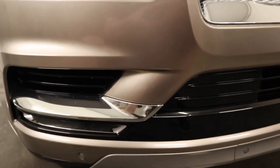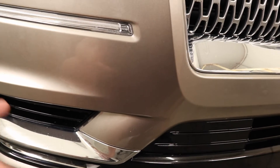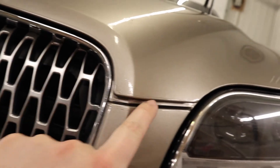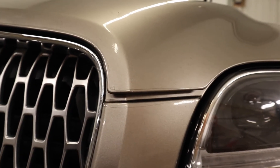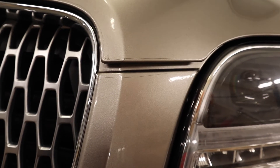Other than that, the installation doesn't look too terribly bad. The alignment is pretty good, minus some edges that have definitely been trimmed. The big thing that sticks out to me is that this hood was not wrapped. This is a pretty easy edge to wrap all the way around, and if a stone hits you over here that could be a lot of damage. This is definitely cutting a corner and should not be allowed out the door. I'm almost certain they didn't properly post-heat and get that edge down.